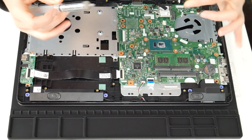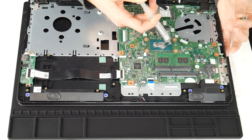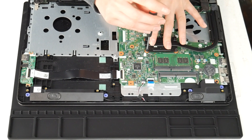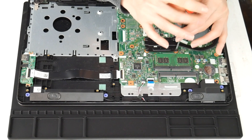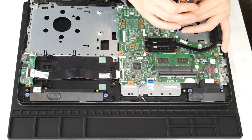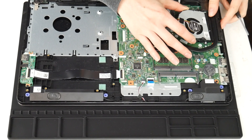The next thing I'm going to do is use some thermal paste on the CPU. I recommend cleaning off the CPU before doing this. As you can see it's dried out and there isn't much on there, so I go ahead and put some new thermal paste. I've included a link below with some good quality thermal paste, because not all thermal paste is created equal — you've got to get the good quality stuff. Also be careful not to touch your motherboard with the oils on your hands. It can cause problems, so hands off people.